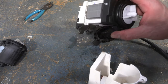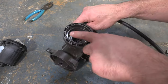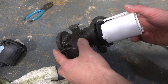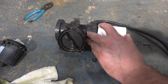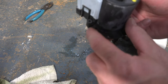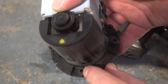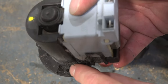Move the old pump to the side — the new pump goes in the same way and should just snap in with very minimal effort. Make sure the area is clean because there's a gasket that rides here, so give it a quick wipe with a towel. Set the pump housing at around four or five o'clock and put the screws back exactly where you took them out — don't over-torque them or you'll strip the plastic. If you forgot where the screws go, look at the dents on your old drain pump to identify the correct positions.